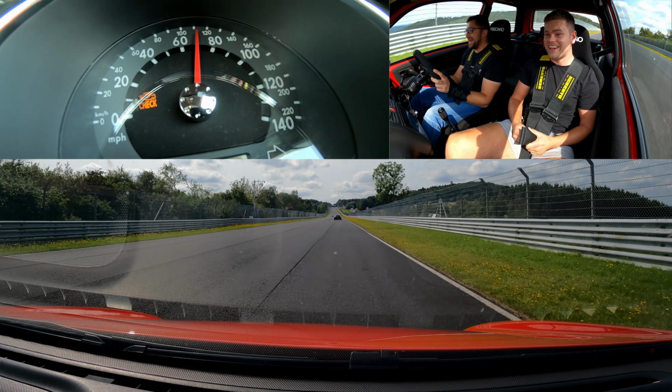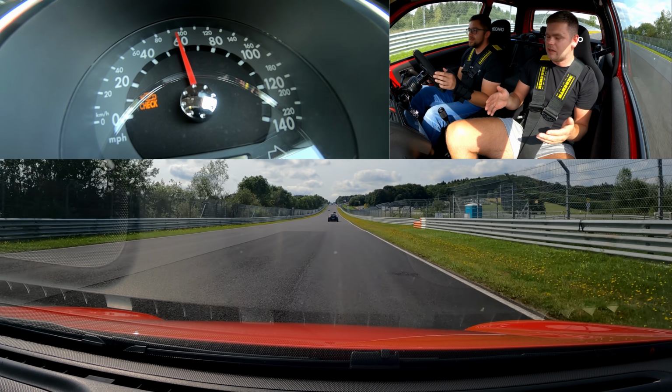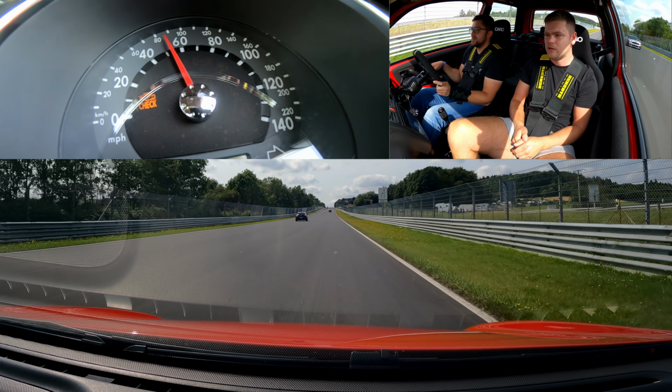Once you get it, you can. I had the car all set up and corner weighted and had the rear axle shimmed last year, so it made it much more controllable. When that used to happen, I used to just snap really quickly. So that's helped a lot.